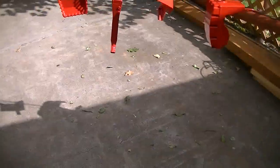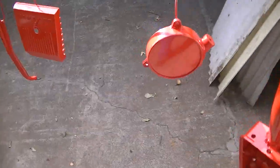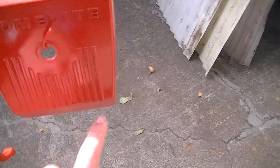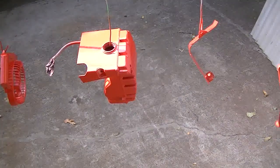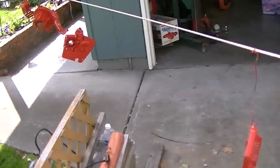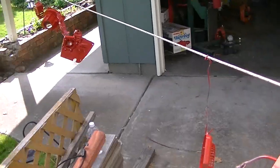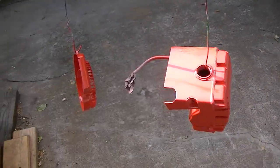But through trial and error — more error — I have learned that this paint does take a good while to cure, about a week. So when you go back to do things like the white lettering on the air filter cover and the stripes, and this one will actually get that green inset pattern, you'll wrinkle the paint. It isn't totally cured, and as the solvent from the fresh paint hits it, it just wrinkles up and you're done. At that point you have to pretty much strip the part down and refinish it. If you choose to use that Duplicolor paint, give it a week to cure before you do any kind of top coat — including a clear coat. Anything applied after one hour, give it that week.